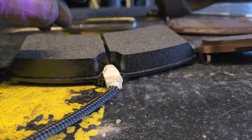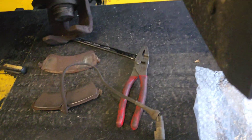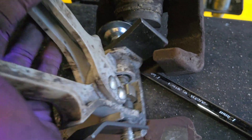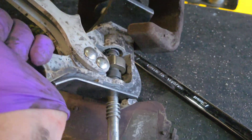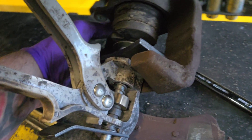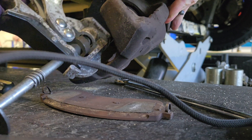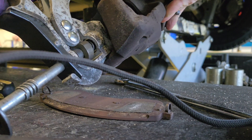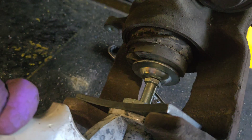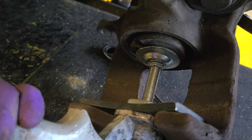It's saying you're not metal to metal yet, but you're rubbing the sensor and it's time to replace it. The new brake pads come with new sensors. Being an electronic parking brake, you need to put it in brake service mode — and you don't have to twist the pistons, you can squeeze them in like normal.